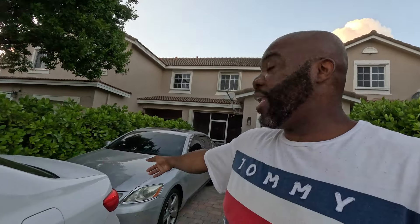I'm kind of happy because I almost gave up — I'm not gonna lie. I almost sold this car and almost put it on Facebook Marketplace. But shout out to my wife again for giving me some motivation and telling me things I really needed to hear. I just couldn't get anything right, but with her motivation she pushed me to keep diagnosing the radio, and I was able to figure it out with just a fuse. Now I have my radio back and AC, which was one of the reasons I wasn't driving this car much anyway.